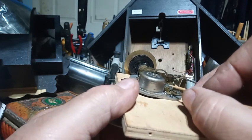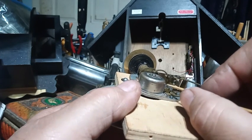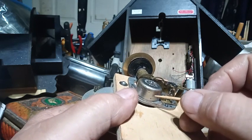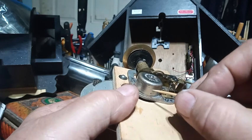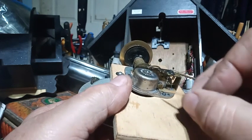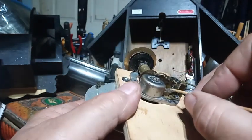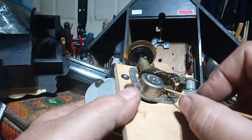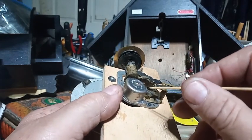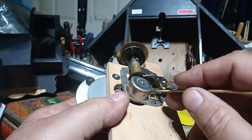There are repairs you could do for that plastic wheel, and I've got videos about this. If the wheel is cracked, with a micro drill you drill on each side of the crack. Then you feed a wire through one side of the hole and back through the other side, and twist the wire until the crack comes together, then snip off the excess wire. You could also put a bushing over that.